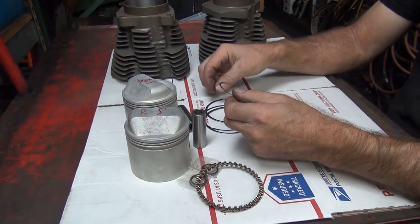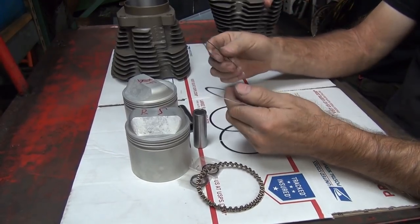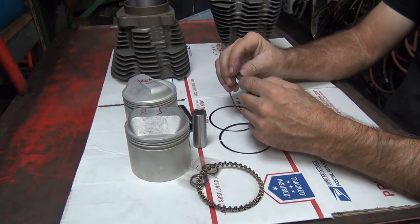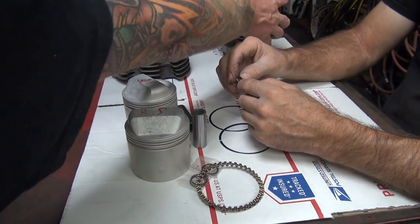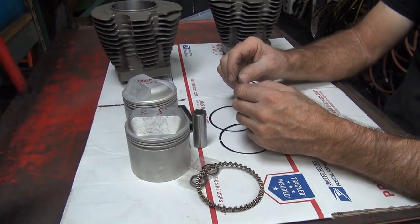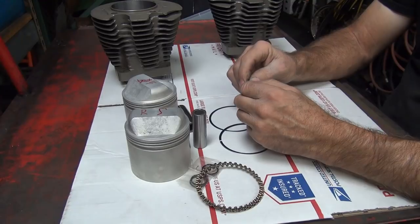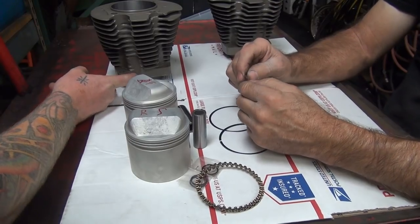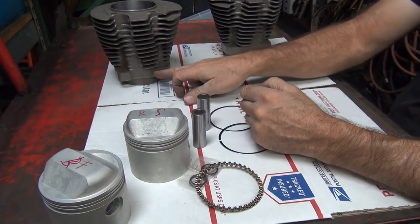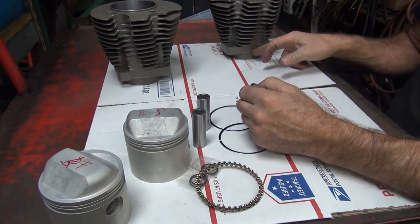That's the rear. How do you know? Because this overhang bit is facing the opposite direction - see how this side is bigger than that side? Oh, is that how you tell? That's how I was able to tell, but that's probably not the proper way. No - because this here is for the exhaust. If this one's broken off, then you get a new one, but you'll still be able to tell. And this is the front edge pushrod clearance. The pushrods are in the middle on the intake side. So if that's the intake, that would be a front cylinder. So you've got two different things to look at - even if all these fins are broken off, you still have those.